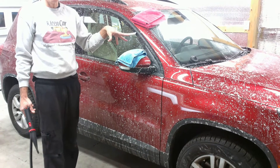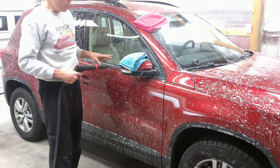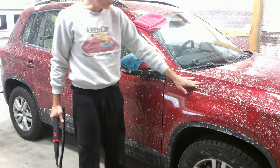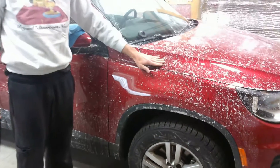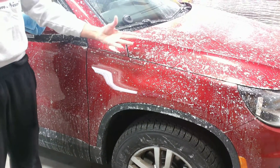That's the advantage of having an injection steamer — the No-Rinse cleaner is being sprayed on the car. We don't just want to spray steam and wipe the car down, we will scratch it. The salt is pretty built up here and you can tell this is like sandpaper, so we have to dissolve the salt and lift it so we're not scratching the car.